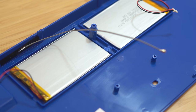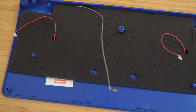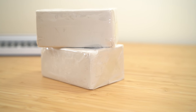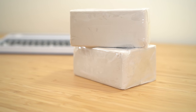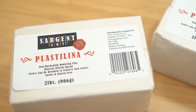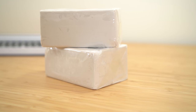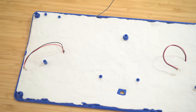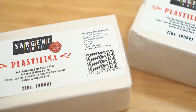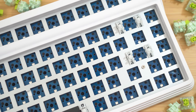All was well until I got to the bottom. The lower case remains largely unchanged, with two huge battery packs and the standard squishy foam to fill that vast empty shell. The space down here is very cavernous, to say the least. So I got an idea. A viewer recommended I check out Plasticine, also known as Plastilina. It's a sculpting clay suspended in wax and oil, so it never hardens — it's not the colorful polymer clay that you bake. Don't use that stuff on plastic; it actually melts plastic. Plastilina is the stuff Gumby is made of, and it's heavy. So I filled the entire underside with it. It took a bit of time but wasn't terribly hard to do. I also put two layers of blue masking tape under the PCB for the tape mod, then put the entire thing back together.